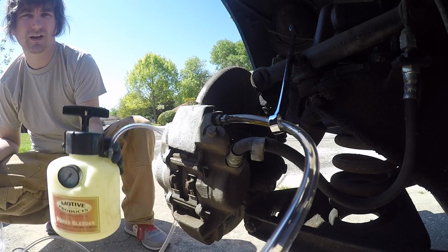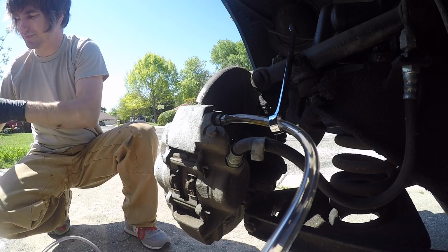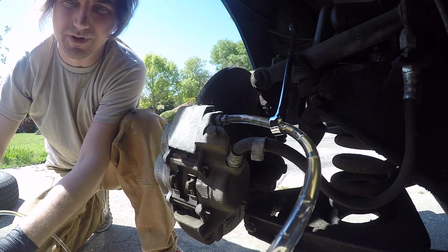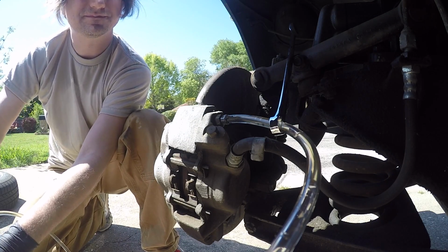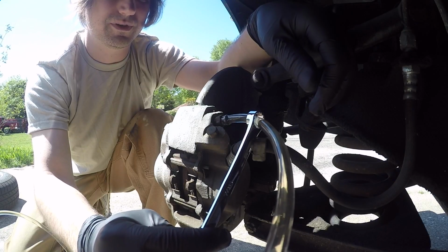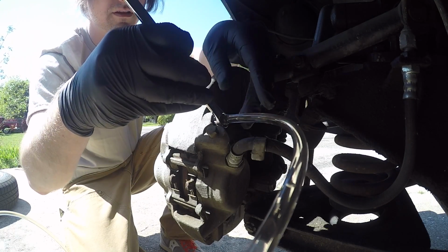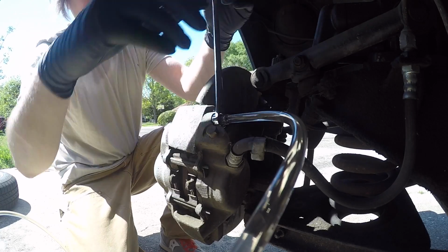And here's a little pressurized bleeder thing I have. So, if I can pop this cap on there and get some fluid in the reservoir here and bleed this out. Well, not perfect. I have a couple drips up there, so I have a rag going, but we'll see. Just basically keep that going until I don't want to be seeing bubbles anymore. It looks pretty good to me. It's cleared up, so just tighten this guy back down, and we'll call this one good.